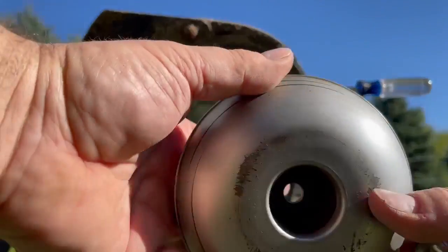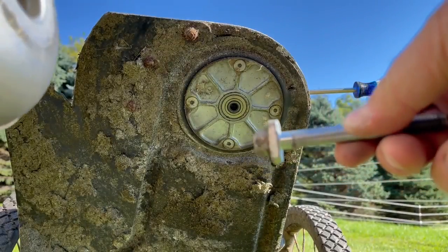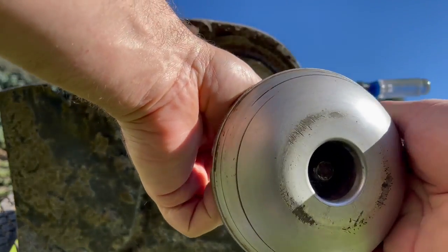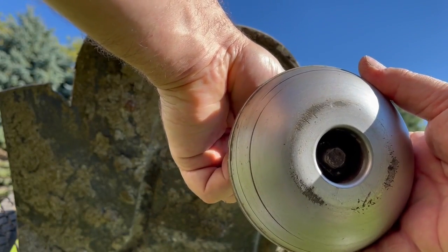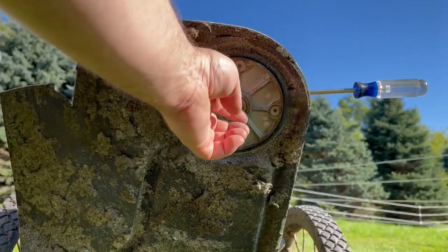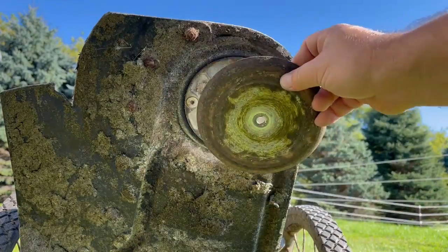In the beaver blade kit you'll get your aluminum ball, your shield that runs on the ground, and a special T-bolt. There's a slot in that ball and the T-bolt needs to seat in that slot — make sure the shoulders of the bolt don't come out of the groove. Then I go ahead and install my plate back on the bottom just to protect the bearings and other surfaces. Different models either have a guard or don't — this commercial grade one does.